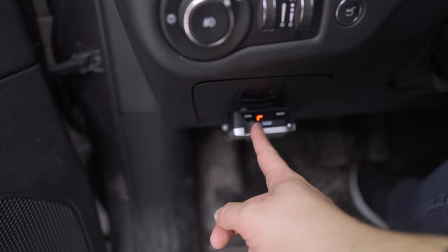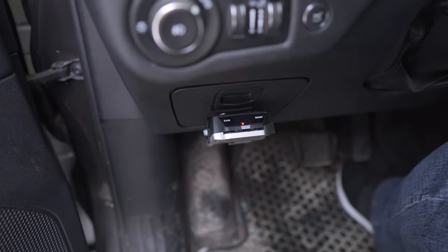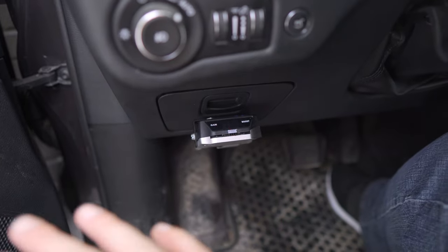The other thing we need to check is whether there's a brake controller. Most SUVs — certainly mid-sized to smaller SUVs — will not come with a brake controller, so you'll have to purchase one aftermarket. Before you do so, make sure you have the correct wiring harness — without it, the brake controller won't do anything. If you're unsure whether your vehicle has the required wiring harness, check the manufacturer's website or your window sticker. If there's anything related to a tow package, you're typically okay, but make sure it supports the 7-pin connection.